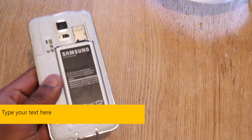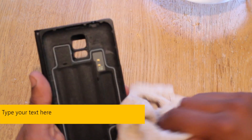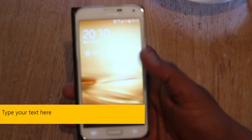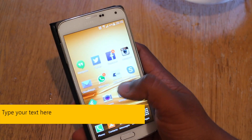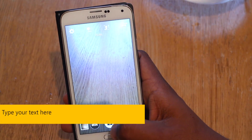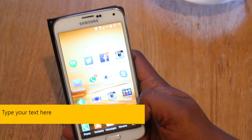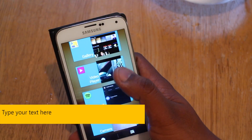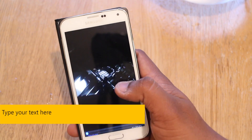Now we've finished. Randomly music started playing. We'll put the phone to one side and turn our attention to the back cover — going around the seal to make sure any excess water is mopped up, and there's nothing inside the seal, which there isn't. Now we put the handset back, turn it back on — and it's working perfectly, everything's working. Big test: is the camera working? Again on this wooden table — camera's working fine. Is the speaker working? Let's go back to our video — you can see the buttons are working, which was a problem we had with the Galaxy S4 Active.